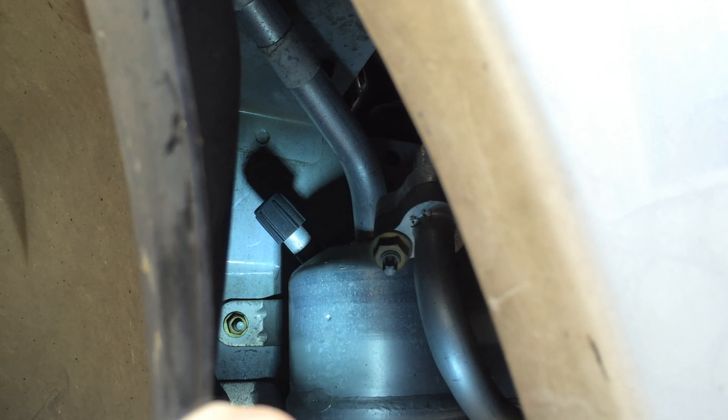There's a look at the compressor nozzle — you can see there's a plastic cap on it. It's a good idea to look at this before you buy your kit, because cars made before 1994 or 1995 have a different type of connector and won't work. The type of coolant they use is illegal, so you'll need to take those to a professional. Anything after that will work.